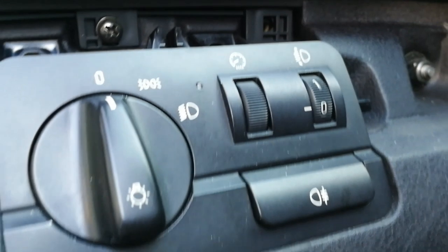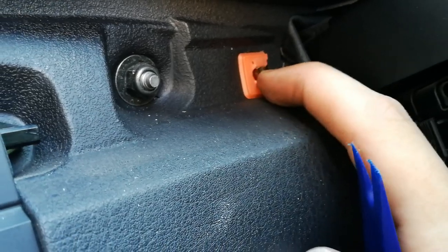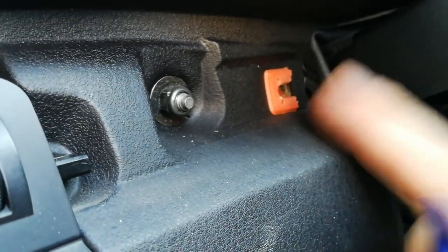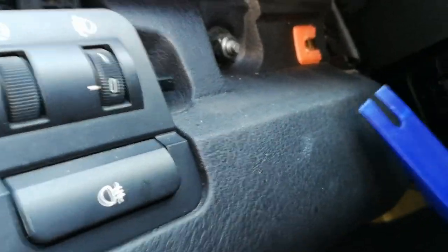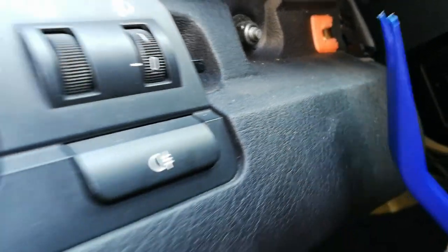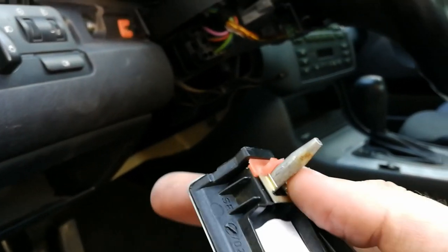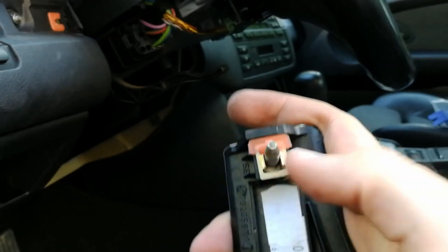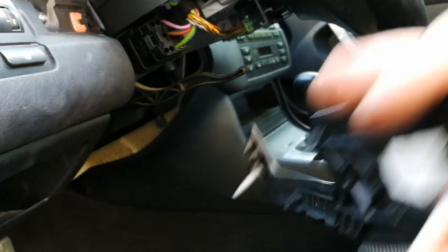Here you can hopefully see where the plastic trim broke, and now I don't know what I'm going to do, but you know, it sucks if you don't know what you're doing exactly. So when you are prying this piece of trim out, now you know, you have to go all the way here and pry it out. The concept is really simple. It's basically just friction on these metal brackets holding the trim piece in. And yeah, well, if you didn't know, now you know.